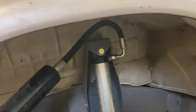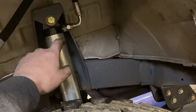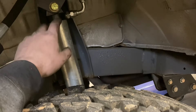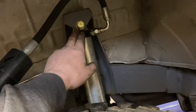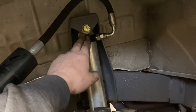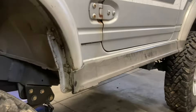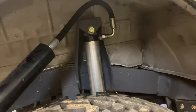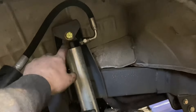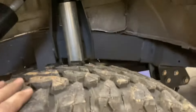Back to this — that one's done, so I'm pulling this one apart. Just figured I'd take a break for a second and video this quick. I just got to pull this guy off and switch out the bushings. I'm going to take it for one more quick test drive just to make sure replacing the uniballs took care of all the little rattles in the suspension — I'm 99% sure it was these uniballs. Just doing the back got rid of the majority of that little clunky noise.